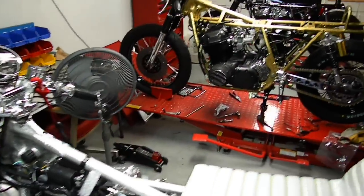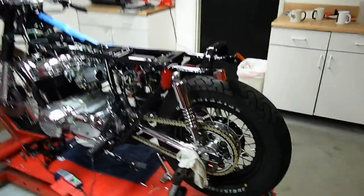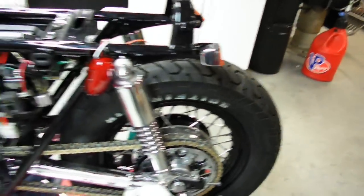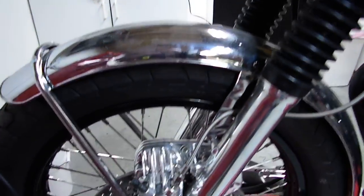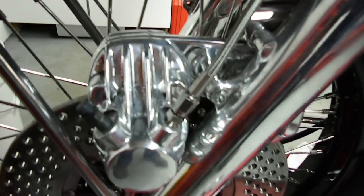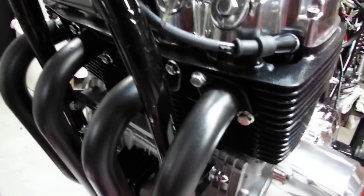I'm also working on another bike in the background — a customer build I'm building from scratch. Pretty much the same sort of thing: chrome swingarm, stock one but re-bushed, X-ring chain, Harley rear end, powder-coated frame, rebuilt motor and carburettors with new pod filters and intakes, new wire harness, new coils, new gauges in silver metal flake. I'm doing the wiring now — shortened the wires and put new Honda ends on. New front mudguard. Rebuilt the brake caliper with a stainless piston — my own piston — and hand drilled the rotor. Performance 4-in-1 exhaust system with new crush gaskets.